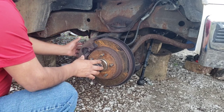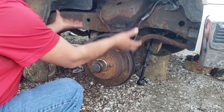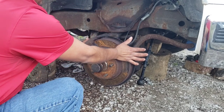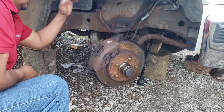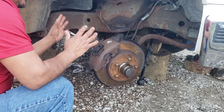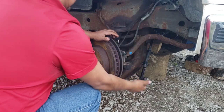To make it easy on this job, if you do the wheel bearing before you raise up your car, make sure you turn your wheel to the left. That way you will have easy access to the bolts over here. It shouldn't be a problem at all.